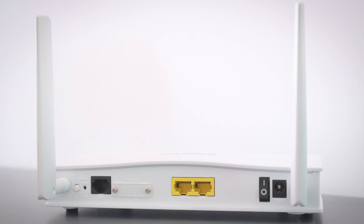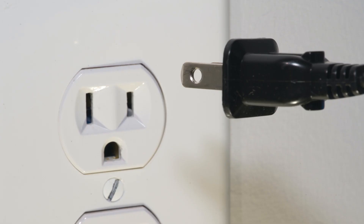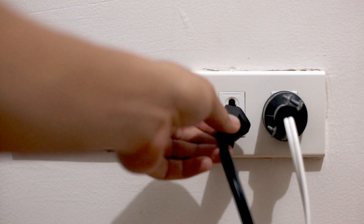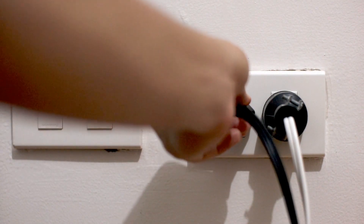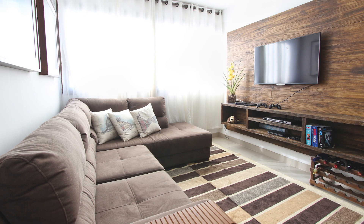The next method would be the push-to-reset button on your modem or your router, if it has one. Not all routers have this button, but if yours does, give that a try. If that doesn't work, find your router that is giving you Wi-Fi and unplug the power to that for 60 seconds, then plug it back in. This is very different from pushing the reset button on your router.